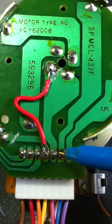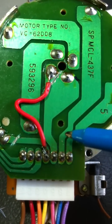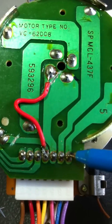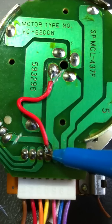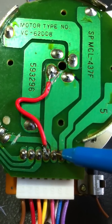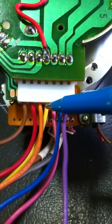Luckily, one of the cores is already connected through to the other, so that one joins on through one coil, through another coil, back to here. This one here goes through one coil, through another coil, back to that point. It should re-wire down to here. So, the two outer pins are either trigger or power coil, the two inner pins are either trigger or power coil, and then you just tap onto these four wires here.